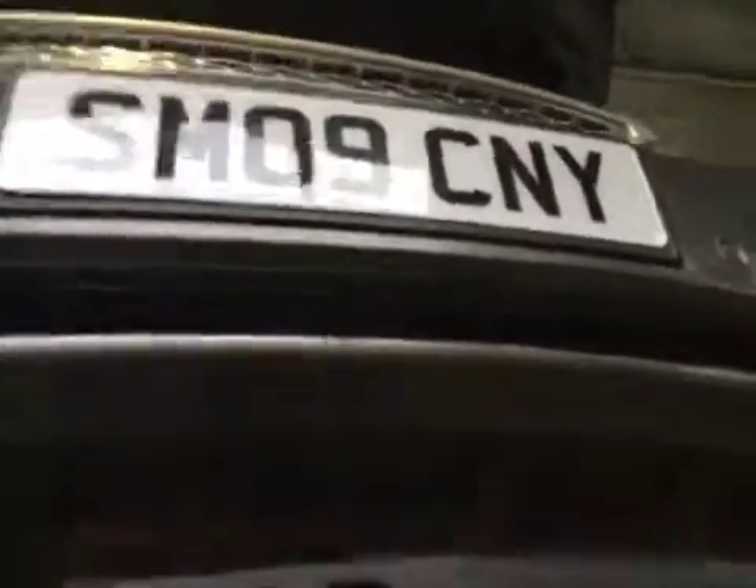Hello, my name's Dean and I'm carrying out a vehicle inspection on your vehicle. This is the passenger side front. Tire is in amber — it's just over to under 5mm. There are no signs of foreign objects inside the tire.